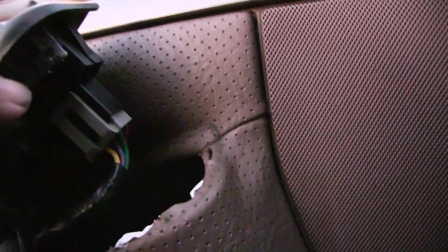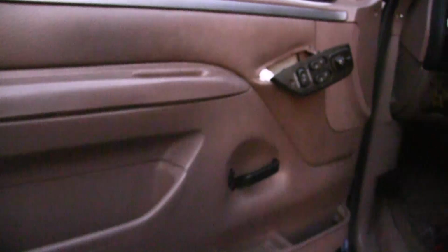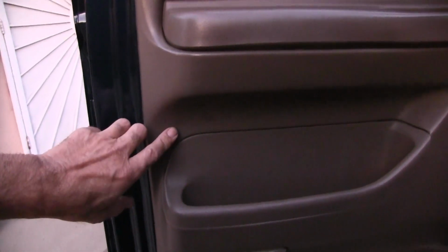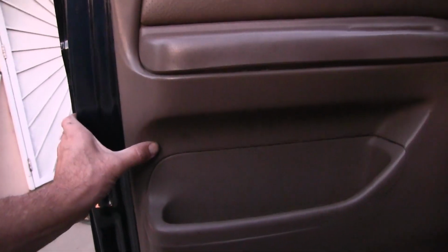That worked there, but on this one, the bracket has a clip right here that's supposed to clip onto a piece of plastic that was broken too. So I did the same thing. We'll see how this works. I just press the epoxy in there and then press the switch panel down in there, so it made somewhat of an impression. Will it work? Will it catch on anything? I don't know, but at least it'll be tighter than it was. So that's it for this door panel. Like I said, you could put a screw in here. I think that's what I did on mine, just to suck it up tight. Other than that, there's really nothing. You got a screw right there. The rest of this is just plugs, and then you got a screw on top. Screws on the bottom. I replaced the screws.